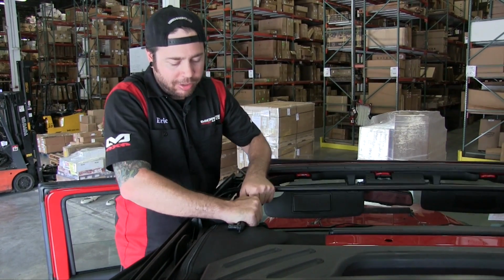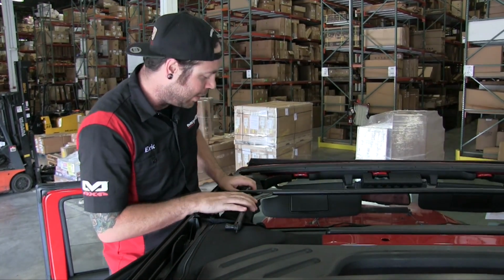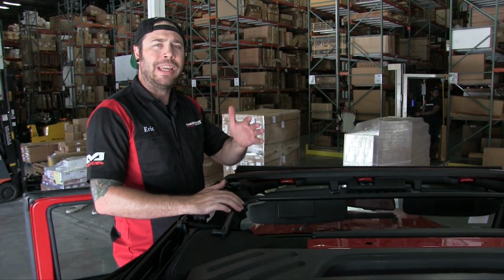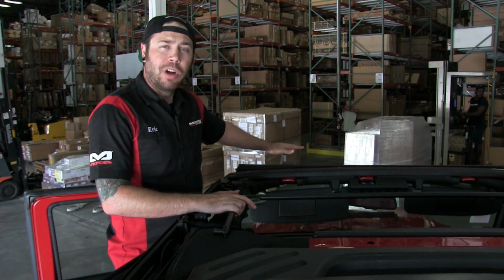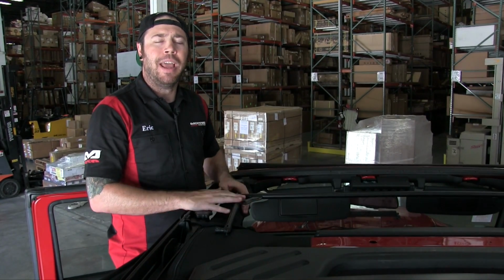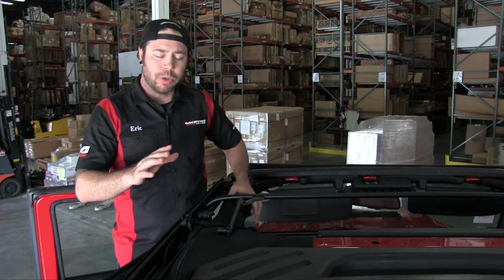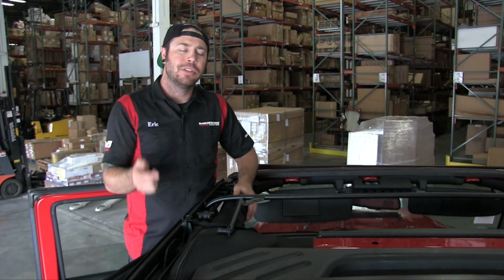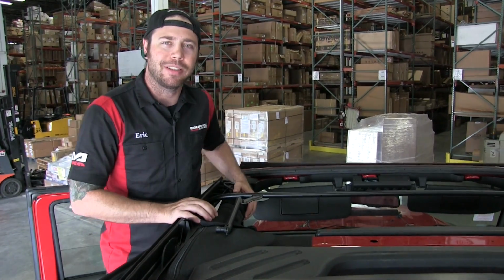And you just want to make sure that they're nice and held firmly in place. Now, once you have the main deck assembly, what you want to do is fold it upside down and lay it across the top of the hood. This will expose the main header and the two side bows, which are going to attach to these little tabs that we installed into the front door surrounds. So come follow me and we'll show you how that's done.